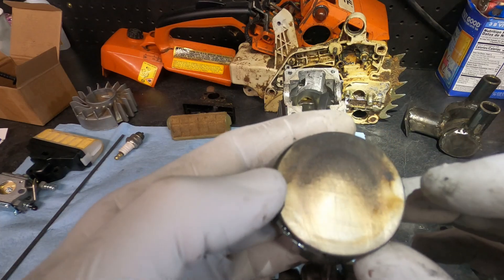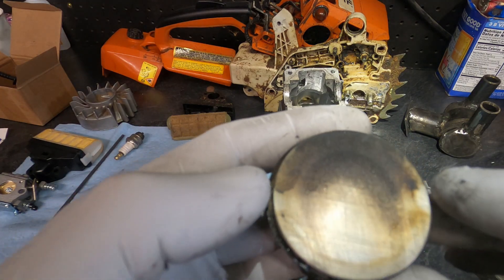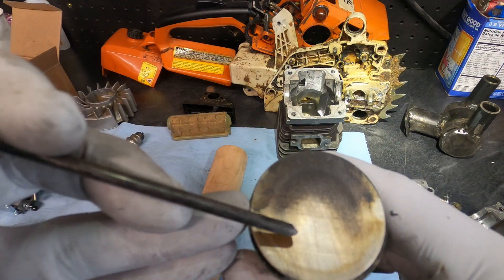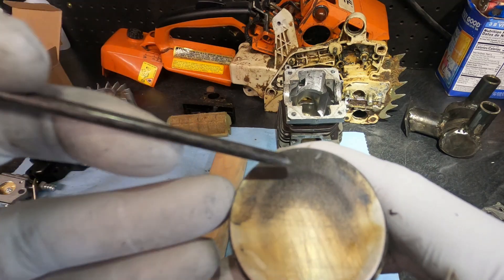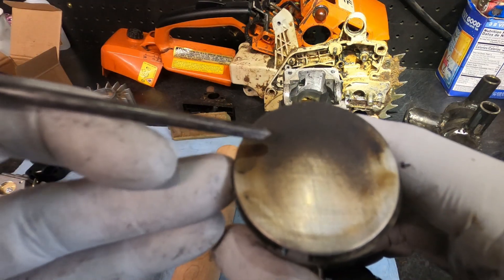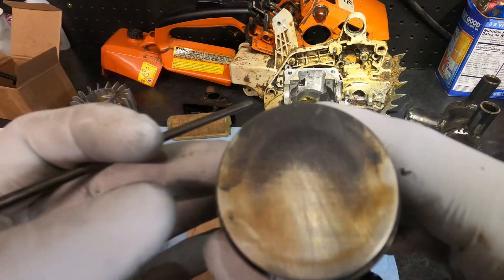Here's the top of the piston — here's the intake side — you can see our flame pattern here. You can clearly see the primary transfers and secondary transfers. Then you can see the combustion pattern shape here: this dark ring that's the edge of our combustion pocket inside of the cylinder head, and we're going to bring that out further.